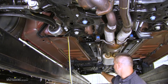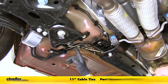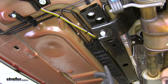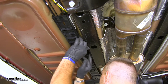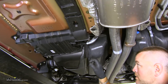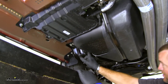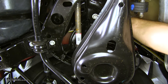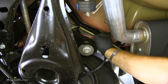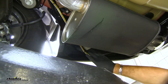Now I'm going to run the rest of the wire back to my passenger taillight. I ran them down from my frame to the top — you can see it comes down right here. Make sure you stay away from moving and hot parts. I found this existing hard line and ran it here. If you pull down slightly on the edge of the plastic, you can take that wire and tuck it up inside where it stays. I ran all the way up here along the tank and floor pan, across, zip-tied it to this hard line, and right to this factory wiring on the passenger side.